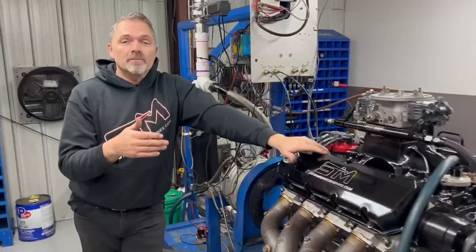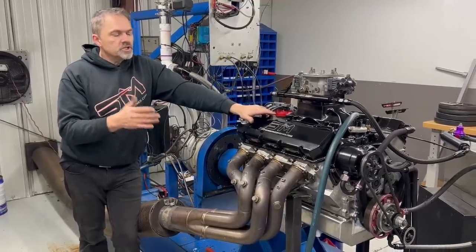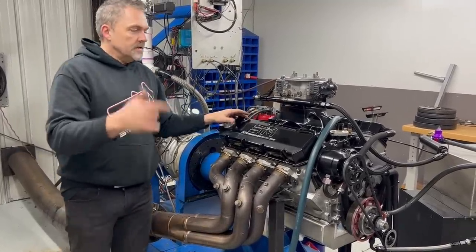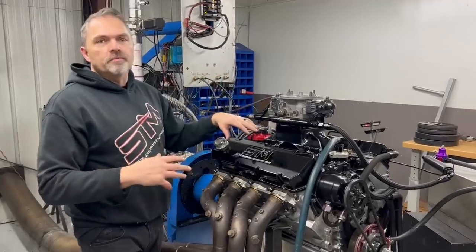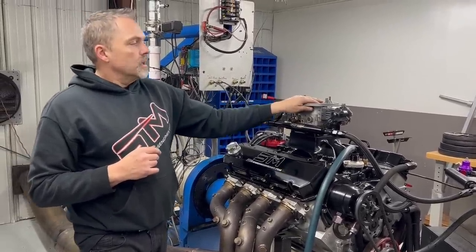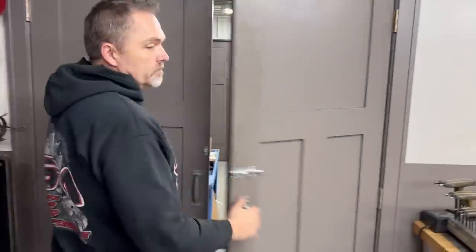Going back to this engine — it made 750 horsepower when it came in. We pre-dynoed it, then went through it with a fine-tooth comb to figure out what was wrong. We did a camshaft change and a connecting rod change, because they wanted to put a steel connecting rod in it instead of aluminum. So again, 582 cubic inch, typical fast bracket methanol carbureted engine. We'll make a dyno pull and I'll talk about the horsepower and where it levels off.